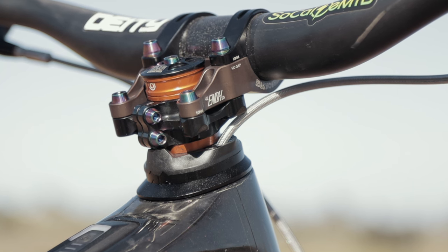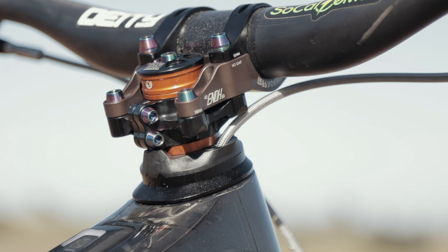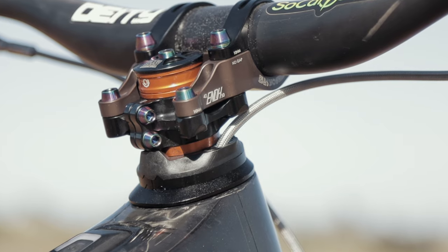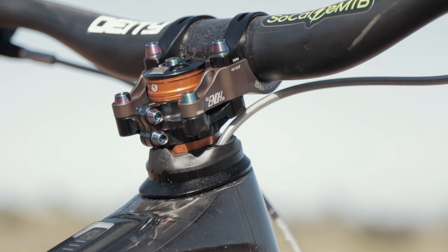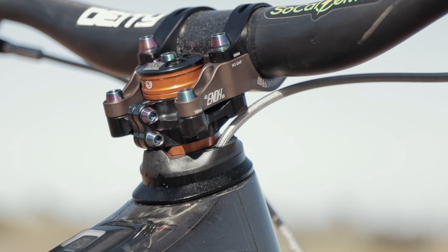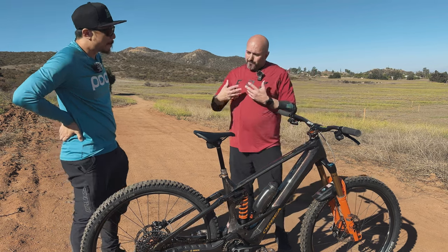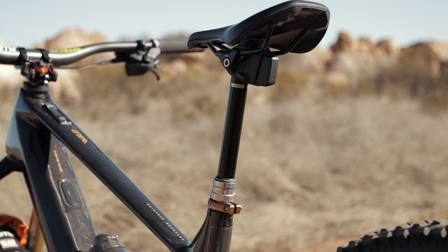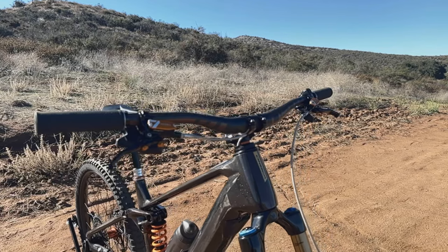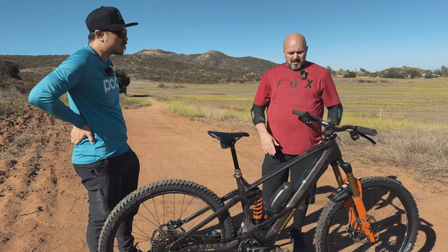At the time, the piece wasn't available without the hump. The hump is hollow underneath, so you can only shave so much before it breaks through. He shaved 10mm off the hump and put a 10mm spacer there — the Yoshi stem clears right there. Now he can utilize any stem he wants, not stuck with the Orbea stem. Removing the spin block eliminated the weak link. He also went wireless for maintenance purposes, getting rid of two cables that run through, and blocked off the extra holes — cleaner cockpit, easier to maintain. If he ever needs to re-grease the bearings, he can do it without a bunch of cables in the way.